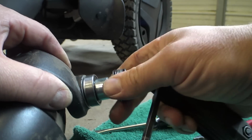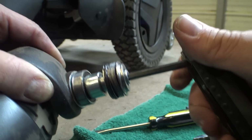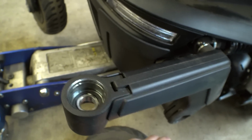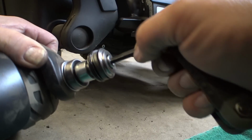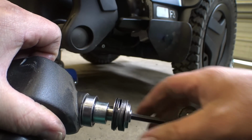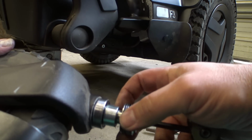Okay, so that bolt tightens down all the way to the shoulder. So turning this bolt does not adjust your tension. That just holds this entire assembly. By the way, there is another bearing in here. It's just not in the stack currently. But it looks like our tension is roughly preset on this. So to adjust it, you would have to add another spacer or something maybe.